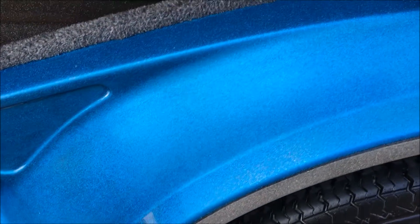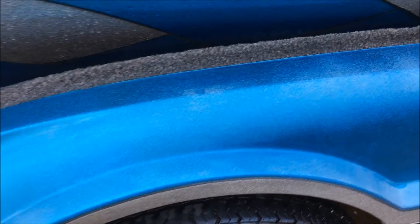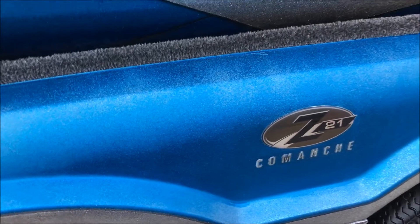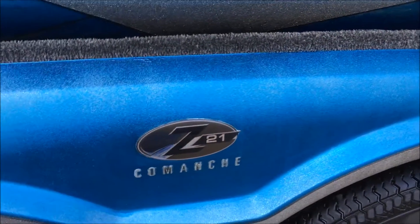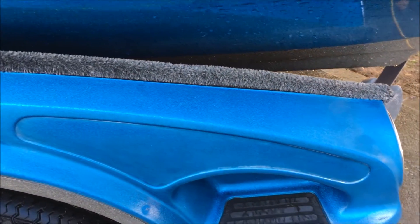As you can tell, the wet sanding is definitely taking down the outside layer, so I'm hoping for some good results. Protec basically tells you to wash it with their wash, then wet sand it, dry it, then go back with a new paint moisturizer and let that sit for a while, then put a buffer to it, and then go back with a good sealant.